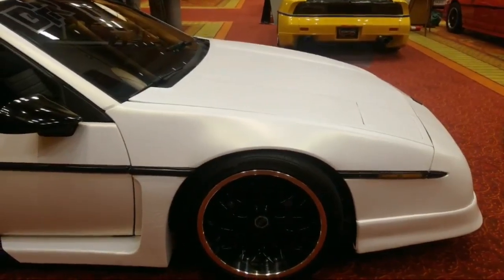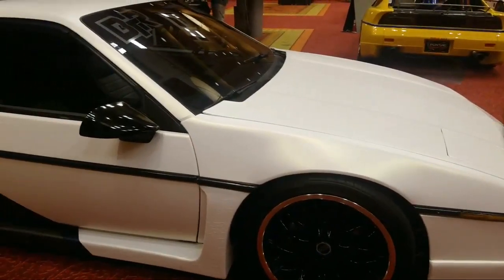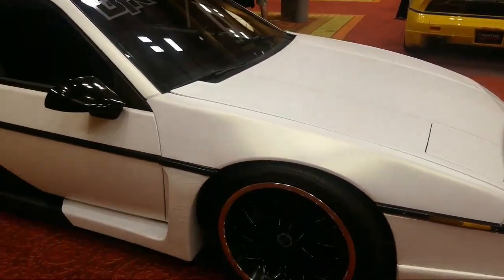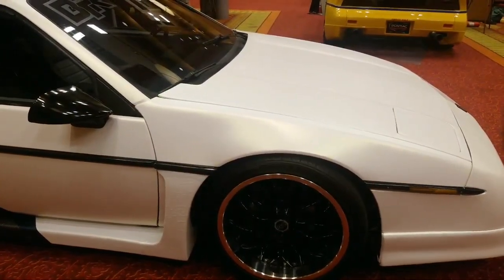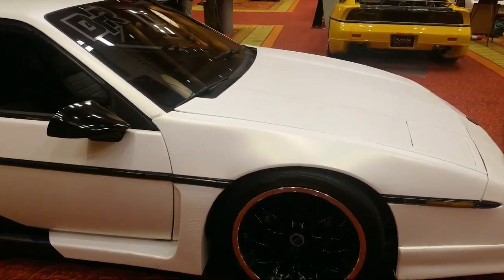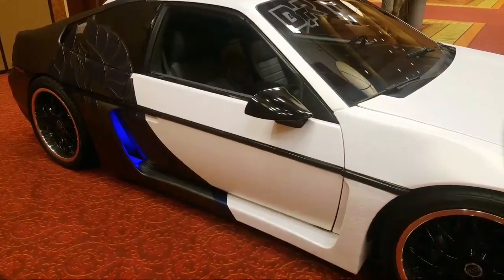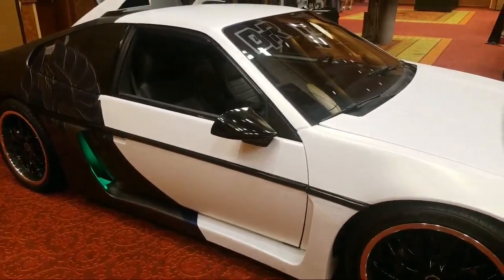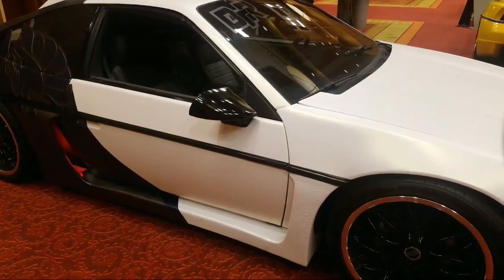That's one I gotta figure out. I'm on cut springs in the front. Yep. Got the two coils out. I've done that five or six times in your cars. Which hurts my feelings hitting some potholes on the way here. It's not bad though. My car's a go-kart anyhow. The thing I like about that is you get it exactly where you want it when you cut them. Yeah, you can get pretty precise. Except you've got to put it all together and let it sit. Got to keep coming back. But you get good at it. Once you've touched it once, it's usually not that hard anyhow.